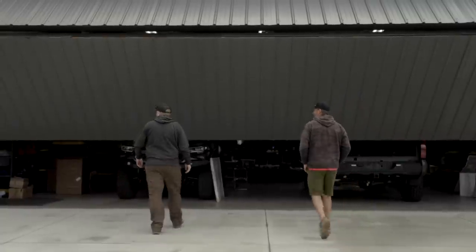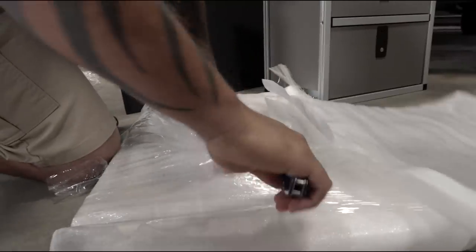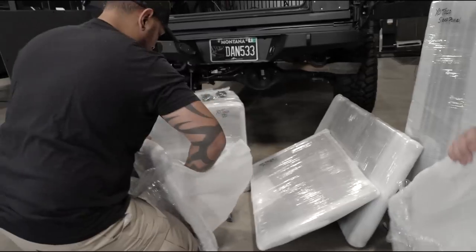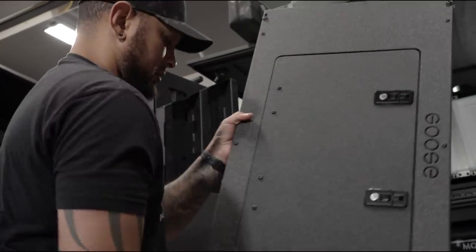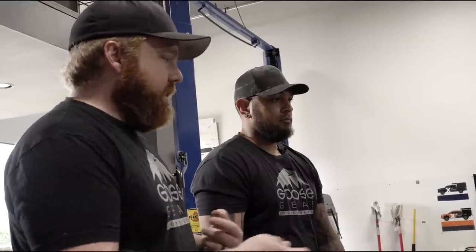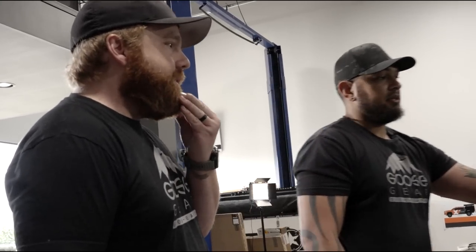You really only need four bolts to mount the whole thing down, but we can get to all of them. For tie-downs — we have a fridge going in — we'll want tie-downs. We drill and put T-nuts in wherever we need those. That's really the unique thing with our bed plates. All of the holes that are already here with T-nuts are designed for our system because we know where things are going to locate.